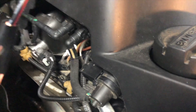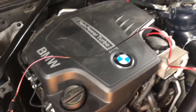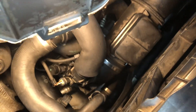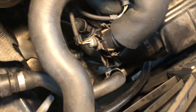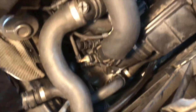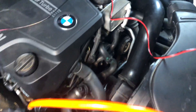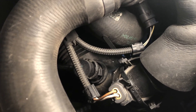After inspecting the engine a little bit, I noticed a small leak — hopefully you can see it. I'm not exactly sure where it's coming from yet, so I'm going to take the cover off and take a closer look. Before I turn off the smoke machine though, since everything is already filled with smoke, I'm going to take my lamp and go as close as possible to a lot of these areas and also go underneath to check for leaks down there. There's also a very small leak on that connector as well.